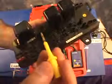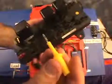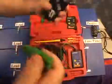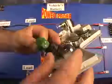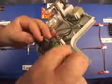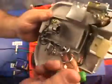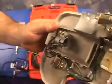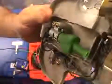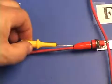In the accessories, you have a blade probe. It's great for fuse terminals and relay terminals. We also have bulb adapters, the wedge-type bulb, and the double terminal, such as the 1157 bulb sockets. And the single-terminal bayonet-style adapter. Bulb adapters are great for connecting the signal to the bulb side of the circuit. A wire-piercing probe, and the back probe.